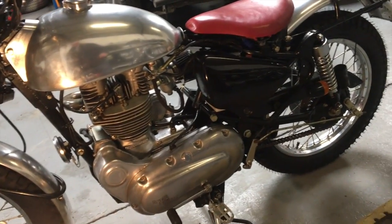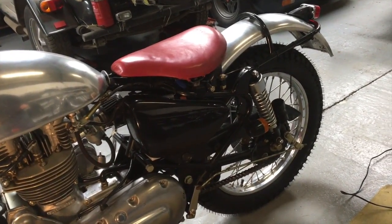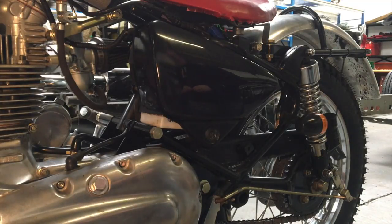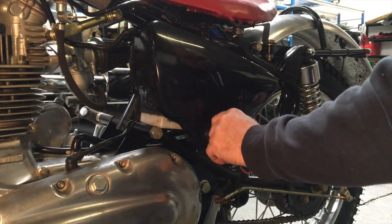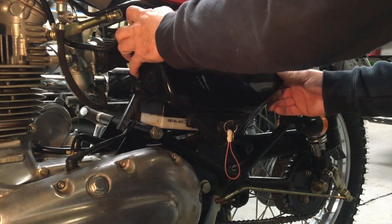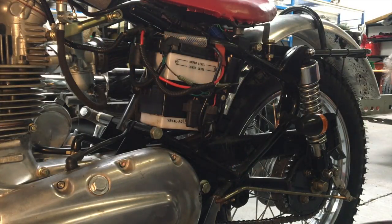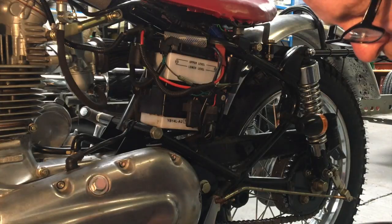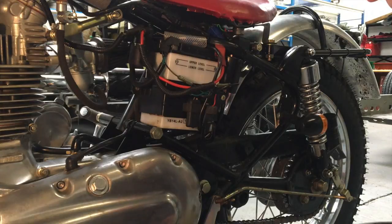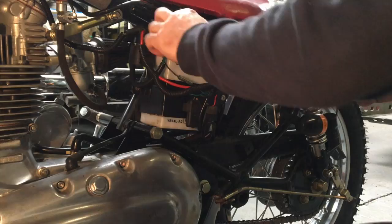Here's the bike we're fitting it to — the Enfield 500 Electra — so it's got a carb and starter motor. The battery is behind that case there. So we need the ignition key. That just falls off those lugs there. Set that aside so we can't stand on it. The tools we need are basically screwdrivers and a spanner. So we need to get to these terminals here, that terminal there and that terminal there on the battery.